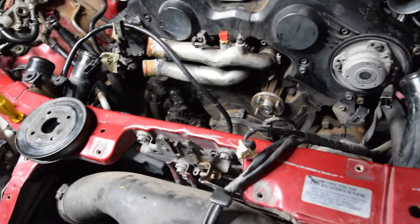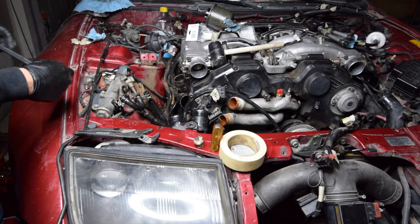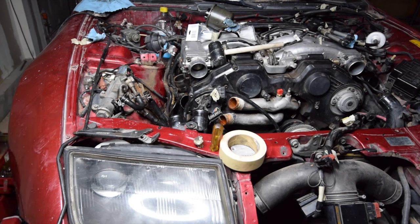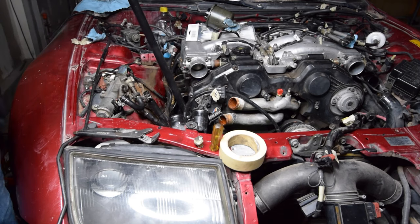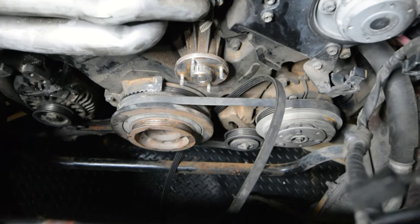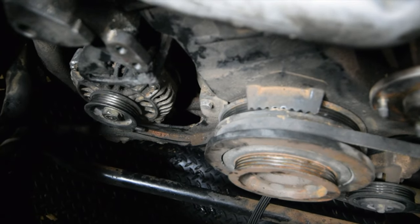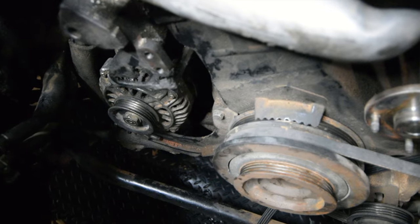I'm not going to swap this belt off. I'm actually pulling the engine, so I'm not too worried about it — I just wanted to get that belt off. I'm going to pull the alternator. Due to the amount of cake and slime buildup, I actually had to break the alternator loose using a breaker bar and a rubber mallet, slightly tenderizing the alternator so it could come loose. Now that I have the clutch fan fully taken out, I'm going to get to these bolts right here — this is a 12mm holding up the bracket that's holding the alternator to the engine. I'll go ahead and unbolt that.